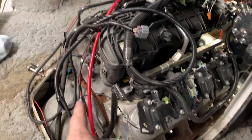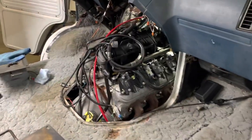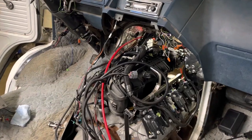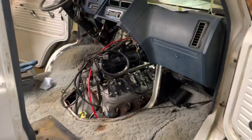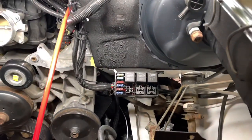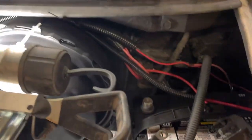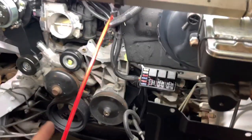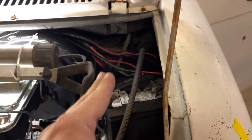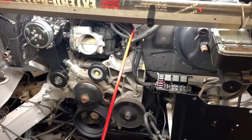Now I'm down to making cables. I've already made the end for this end of the starter cable. I've got it strung up around the top of the motor. None of this wiring is routed in its final location as far as looking pretty with zip ties and all that — right now I'm just trying to get a length for my cable. I'm probably just going to loop it over the top of the booster with all the other wires over to this guy. I'm going to string that over there, mark it, give myself an extra couple of inches, then cut off the extra. I'll show you how I crimp them. This is a two gauge cable, by the way.